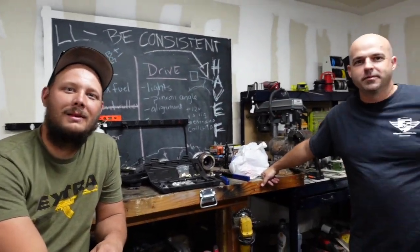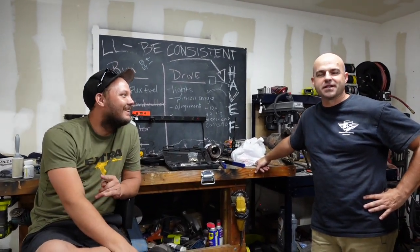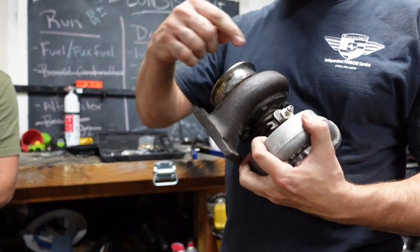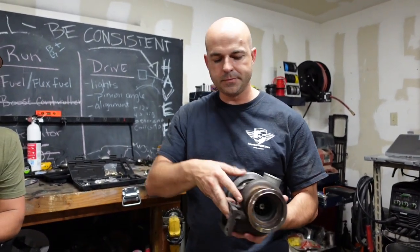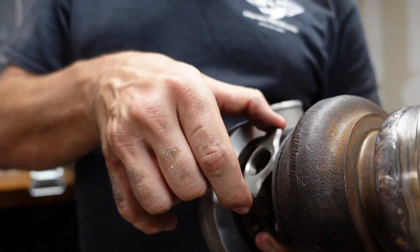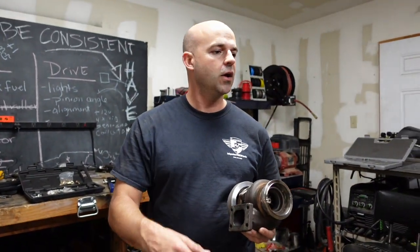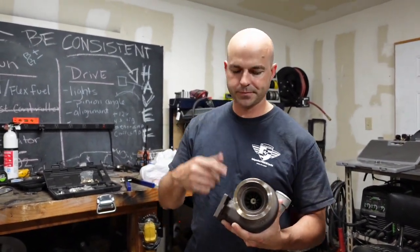And the new cameraman. This is exciting. We are going to do the turbo oil drain and feed tonight on my little Garrett T25. We already have a fitting here, but we're going to show you where you tap on the block to get the oil feed. We've got to do something with this drain. We've got flat spots here so it won't take a normal two-bolt flange, but we're going to make it so that it does. We're going to drill this out, and then we'll get a flange and drill that out.